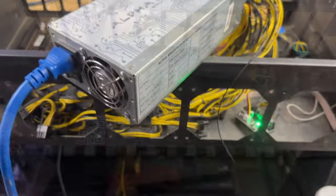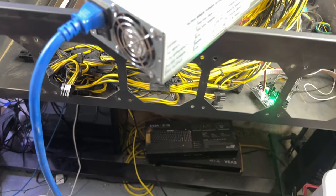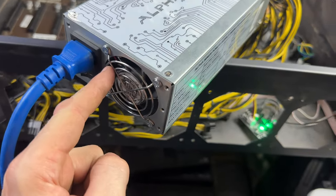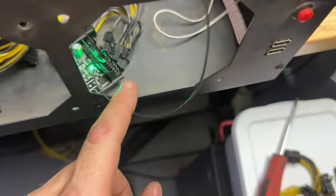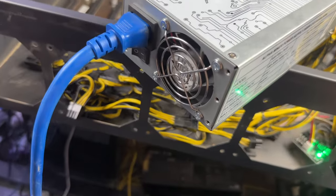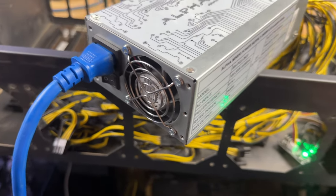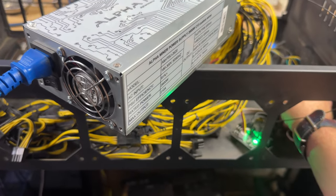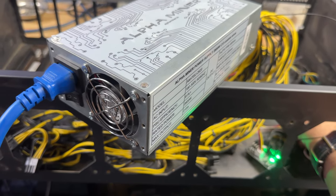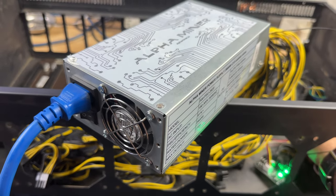See what's what. This took more troubleshooting than I care to admit, but I soldered the blue wire on this fan that they cut off and left there into that pin on the PWM controller, and now it works.